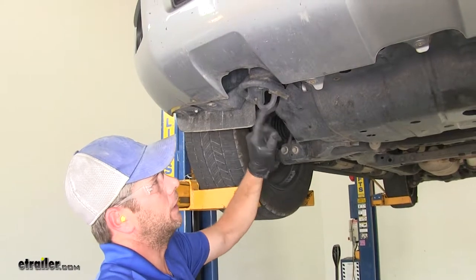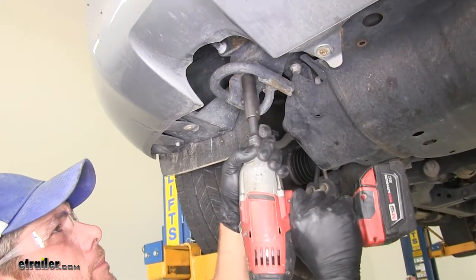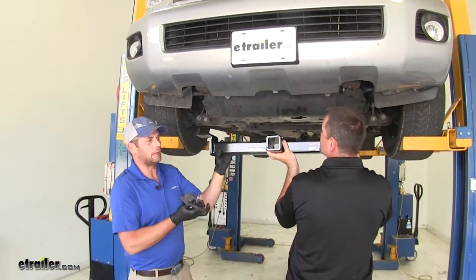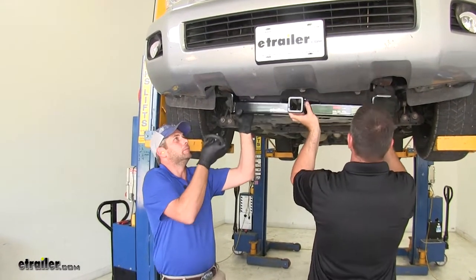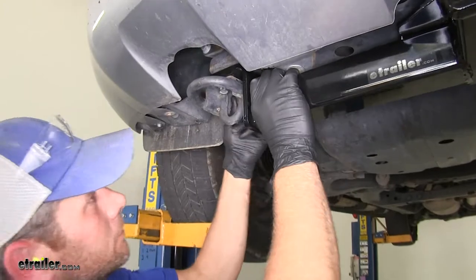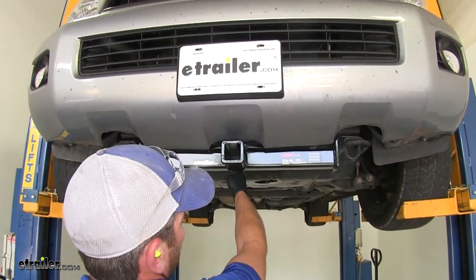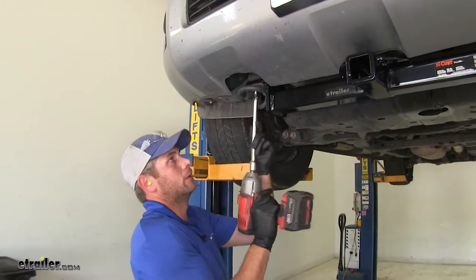Using a 17 millimeter socket, pull out the two bolts holding the tow hooks on each side — this becomes the attachment point for our hitch. Repeat for the driver's side. With an extra set of hands, lift the hitch up into position, sandwiching the side plate between the tow hook and the frame. Get the holes aligned and use the existing hardware. Get four or five good turns on one side, then start the other side. The hitch has a little adjustment side to side, so make sure it's centered with the receiver tube, then snug down the hardware and torque to specifications in the instructions.